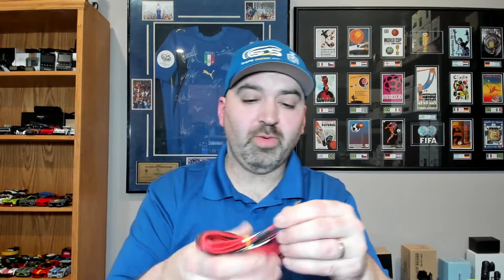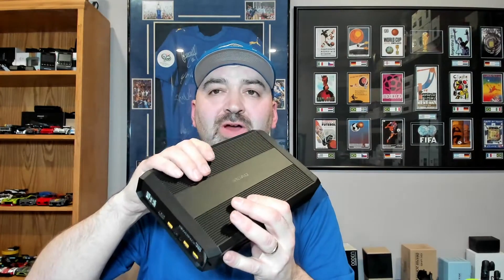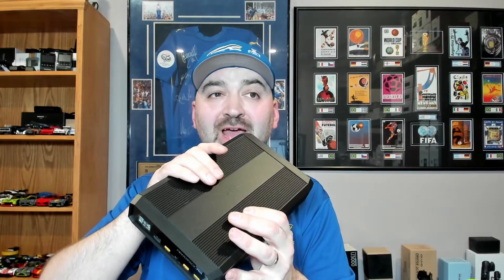The installation method is very similar to the iVolt Extra. It has three wires: constant power, ignition, and ground. As an installer, I'm more of a fan of this because of the newer vehicles on the market. It has outputs for power, ground, and ignition — red, black, and yellow — just like the other dash cam battery packs. I've been using this one for about two and a half years and I was still getting 48 hours of record time out of a 250 milliamp hour dash camera.